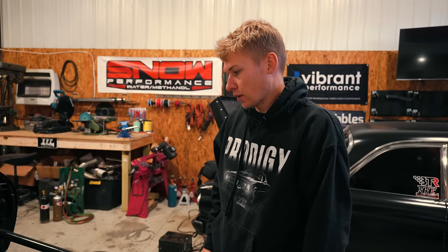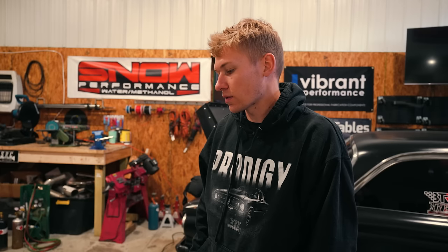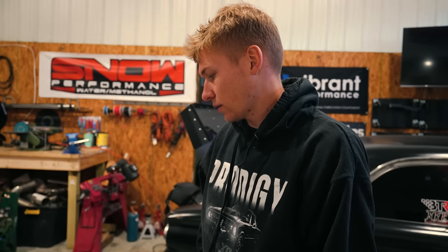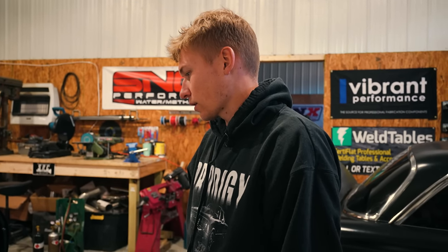I've got all my tunes saved from last year, so it's pretty much the same engine, and it's sorted out now, and you know, the pistons aren't hitting the heads, and one deck height isn't 20 thousandths taller than the other side to side. The Mallory metal isn't MIG welded in there and grinded off the crankshaft. Hopefully better luck next time around.